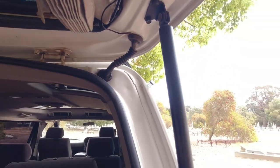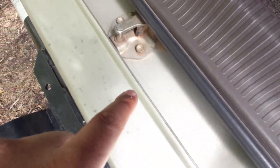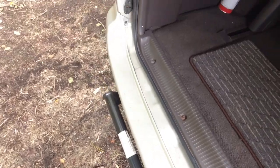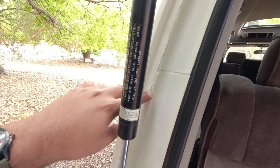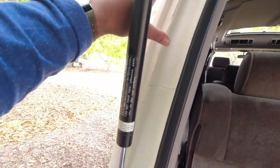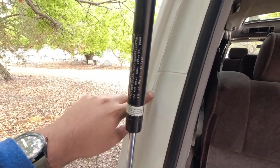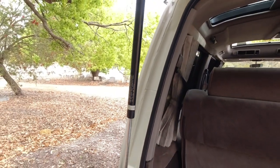If the car is being used off-road, this tailgate area, even though it's watertight because of this weather seal, will collect a lot of dust and dirt, and it'll sit around these latch areas here, so you can tell if the car's been off-road. Again, if you see bits of silicone, this is normal. This is a major part of the car where different components come in, so it's all seam welded, spot welded, and then also covered up with some liquid sealant, so that's pretty normal.